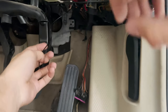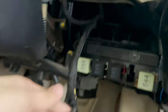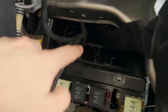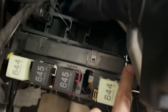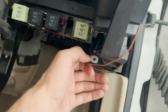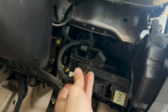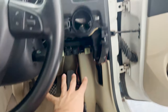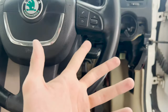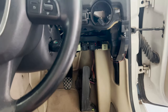Once you hit that lock, you're good to go. To route the wire better, I taped it along the original wiring harness as far back as I could, and did the same on the BCM's connector. The wire goes from here on top of the BCM on the side and to the connector, so it's pretty well concealed. This part has been completed. Now we just need to put back everything we removed, connect the new auto headlight switch, code it, and then test it. Installation is the opposite of removal so it's going to be easy and straightforward.